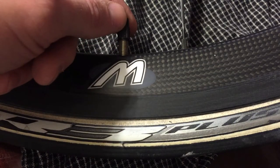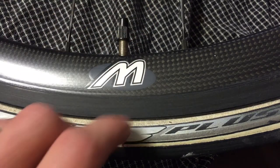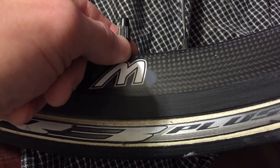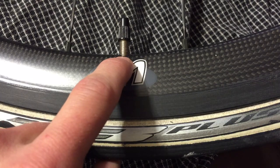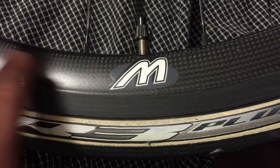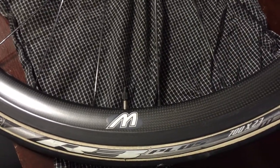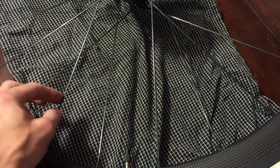Next, look at your valve stem. Check for cracks or damage around where the valve stem sits, as this can compromise the integrity of your wheel. If you find that it's rattling, you can put a piece of electrical tape around it to secure it, or wrap a little piece of electrical tape around the stem when inserting the tube to keep it snug. Like you did when you first got your wheel, check your spokes periodically for tension by plucking them and listening for tone. Also, periodically take it to your local bike shop to make sure the wheel is running true.